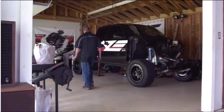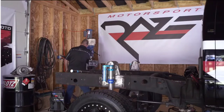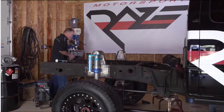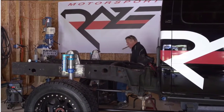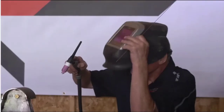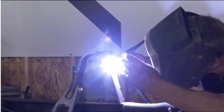This is Tom Hill. I met Tom when I was 13 years old. I grew up racing ATVs, and at the time there was nothing else in the world that mattered to me. My first time meeting Tom, he was tuning his drag race ATV — and this wasn't just any ATV. It was a twin-cylinder, two-stroke, fully built engine he personally designed and machined from scratch. It ran on alcohol, and he would pressurize the crankcase with 100 pounds of nitrous oxide, spraying two pounds through it in a seven-second quarter-mile pass. When you're a 13-year-old kid obsessed with engines and ATVs, watching a guy make 500-horsepower dyno pulls with a quad — let's just say that first impression was imprinted forever.